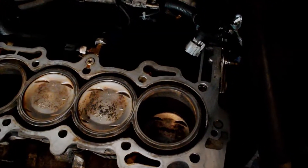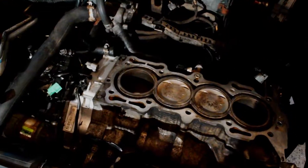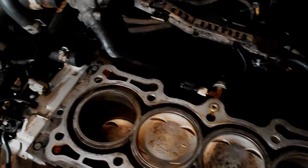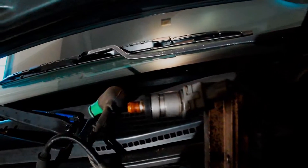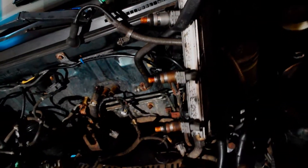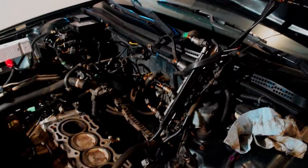I went to go get the cylinder head today and it was not yet ready, so I'll go again tomorrow — the guy says he'll get to it tonight or tomorrow morning. I still have to clean up the valves. I did a little bit of work over here cleaning up the pistons — they look a lot better than they did; they were all carboned up, looked like they had barnacles on them. Got rid of all that with a little brake clean and a wire brush. I also cleaned up the engine block with some Scotch-Brite and cleaned the fuel injectors, which were full of sludge.